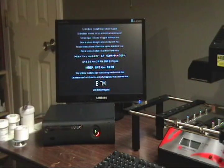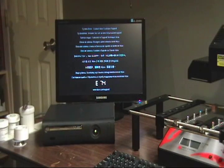I'm going to pause and move over to my other bench and show you how to take it apart. But before I move over to the workbench, I wanted to show you how to test your error code. Basically you hold down the sync controller button and then push the eject button four times. Each time you press the eject button the lights will flash a different color giving you a four digit code.